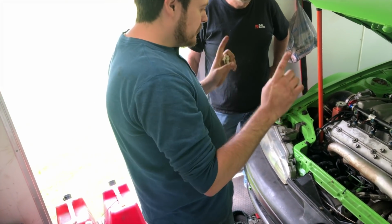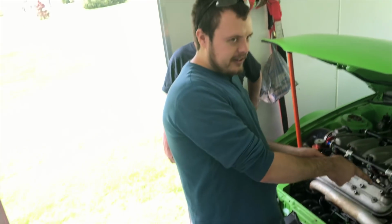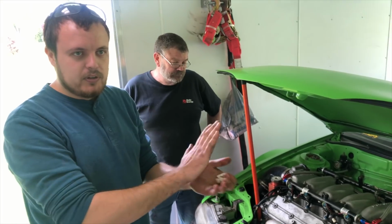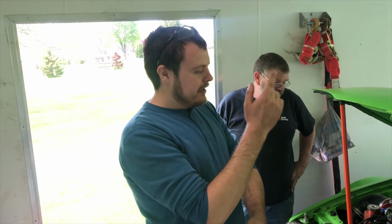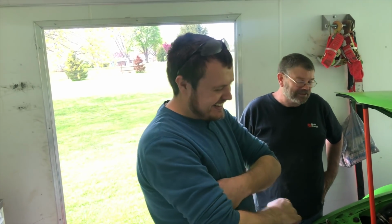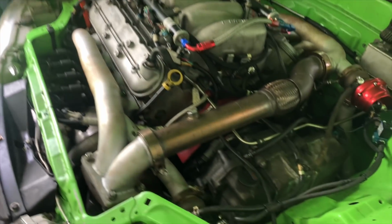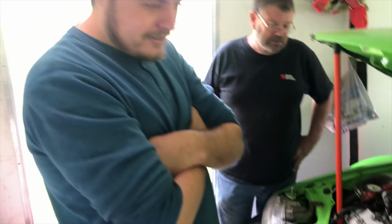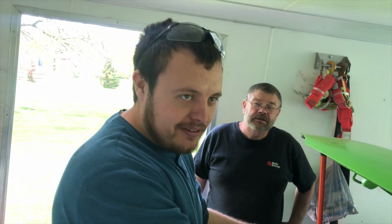So the big limitation that we've been running into is the factory computer. Obviously, they do the torque management. They modulate the line pressure to get it to shift softer, and when you disable that, it shifts very hard. All the time? Yes. On a rear-wheel drive car, it just squeaks the tires and you keep going. On a front-wheel drive car, squeaking the tires, it's an open differential as well.